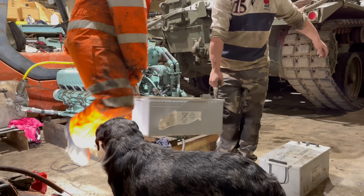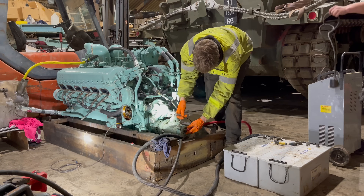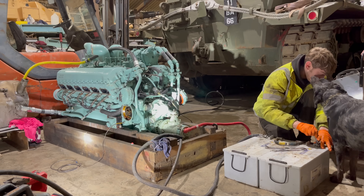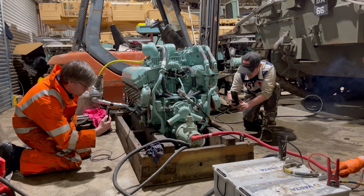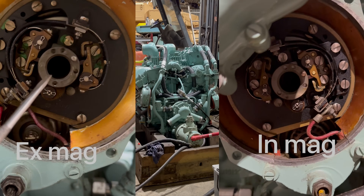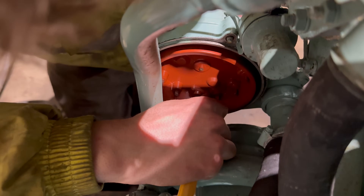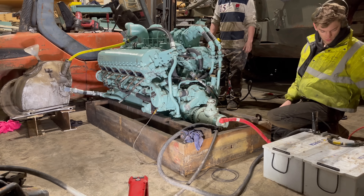Now, you need pretty good batteries to start these engines. The faster you can actually make them turn over, the easier they start. When running them for the first time, I always connect my charger on boost at the same time. Now we know both mags are sparking quite well at the points. Next thing to do is clean up the caps — there's a bit of corrosion on these — and then we'll actually try for the first start. Three, two, one...